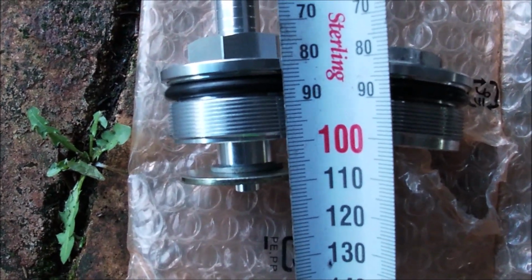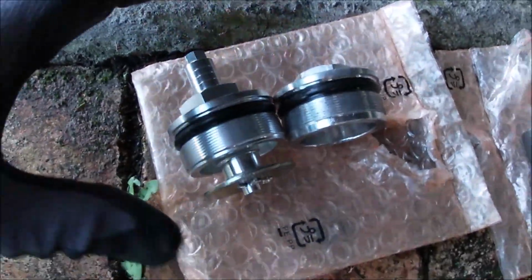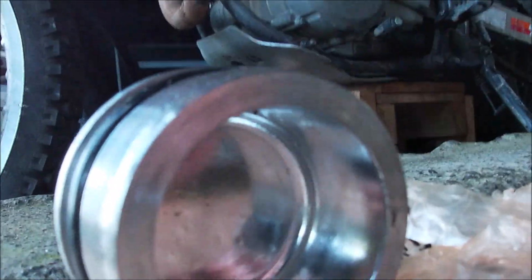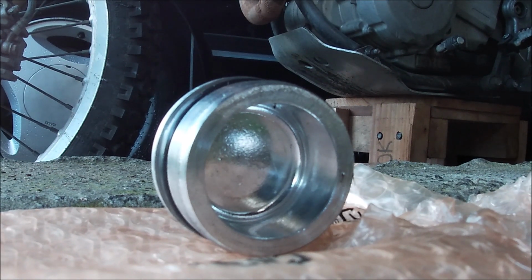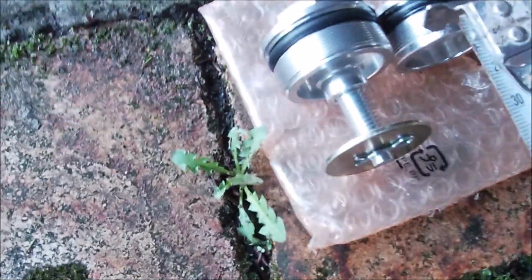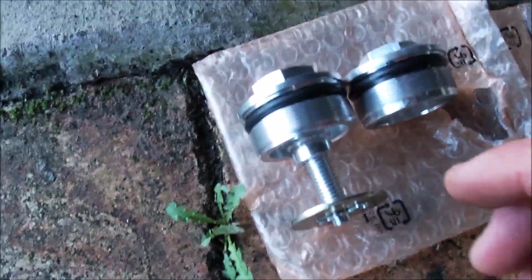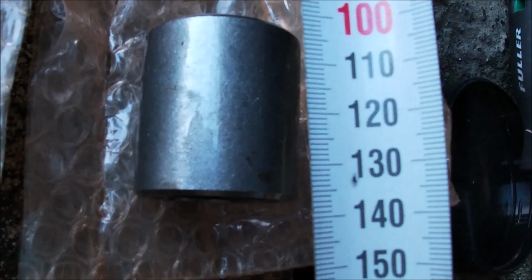And if we open the cap completely, which will be the maximum preload on the spring, that'll be, one sec, there you go, just lay it closer together. So this is how much you can preload. It's about 30 millimeters. So total, with the additional cap, you'll get 30 millimeters of preload. Some people complain that these bolts are going to get undone, but I will keep watching and I will share the video later. So this is the original spacer, which is 40 millimeters.